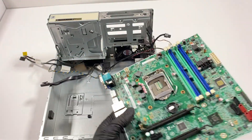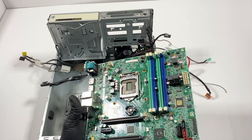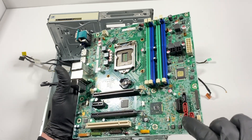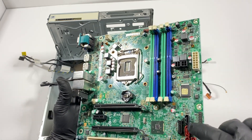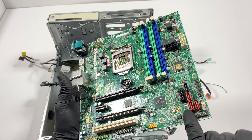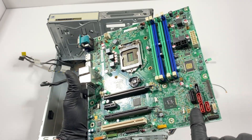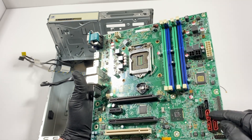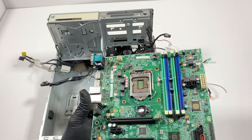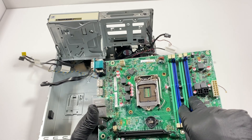Here's the motherboard — it's actually Micro ATX. For those wondering about SATA ports: SATA one is right here, SATA two is here, that's the eSATA, and SATA three port is right here. SATA one — the main one for the boot drive — is in the bottom corner; that's number one. Number two is right here, number three is here, and the black one is the eSATA. The green RAM slots are channel A dual channel, and the blue ones are channel B.